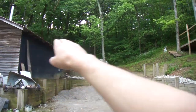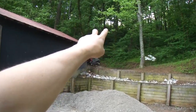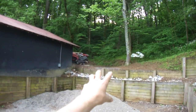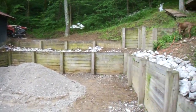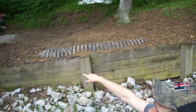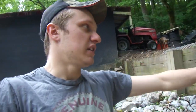Basically I'm putting a roof over this right here. I had to get water that's coming from down this big hill behind me — there's like a ravine right through here — and I had to get that water from basically around this wall or under the wall, because water coming over walls is not good. It's been pretty green and moldy back here. I'm a civil engineer, that's my job, so I deal with this stuff. I took an 18-inch pipe right there and laid it flat, cut a hole in it.